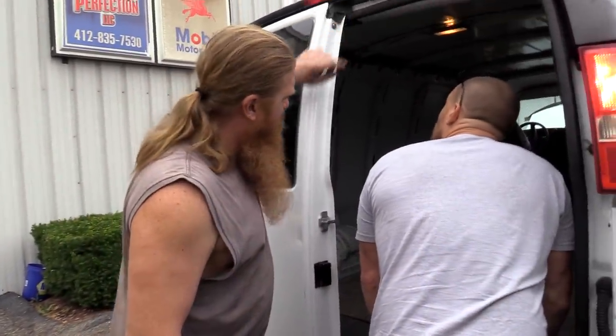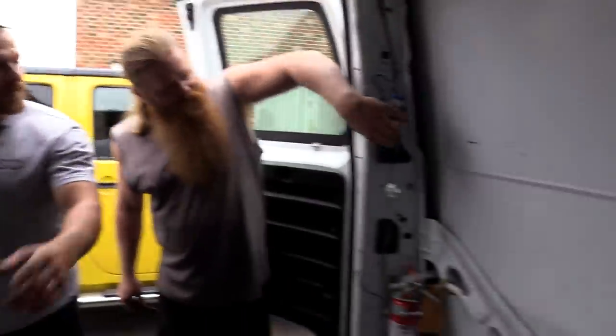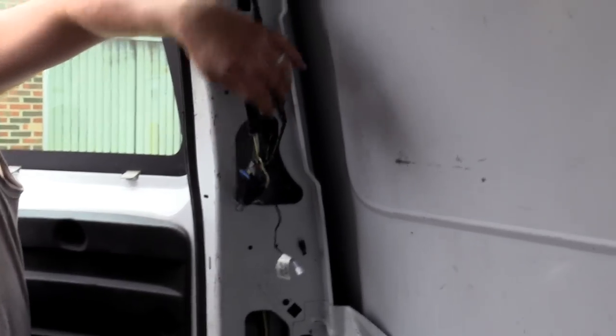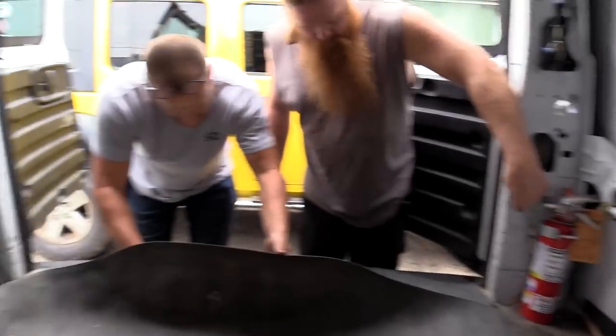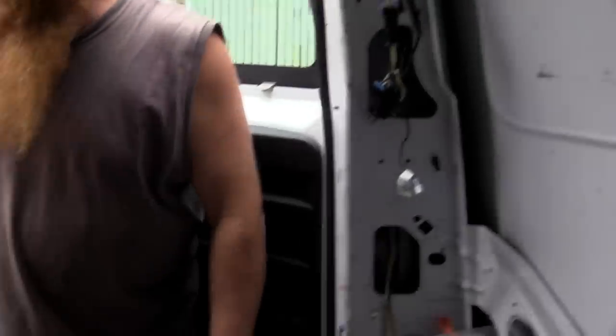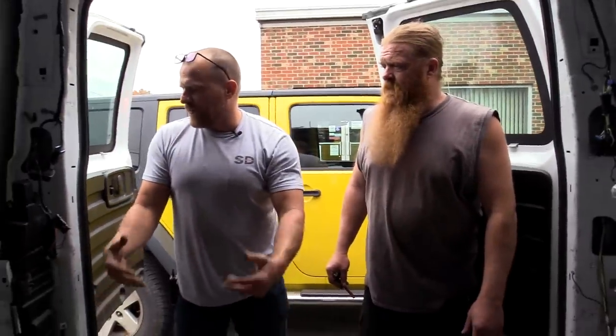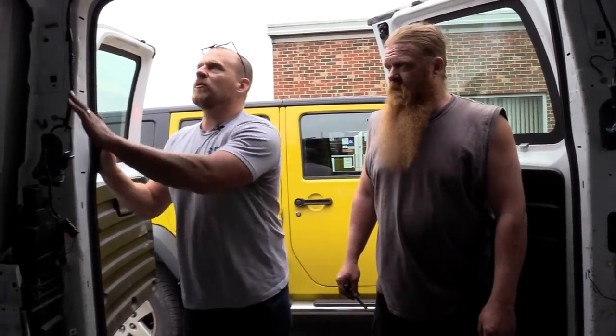This whole thing's been taped up - someone, they're electricians by trade so they work on big stuff. These jumper things go down to trailer stuff and there's a ground that's off here. I'm thinking about whether this is arcing or backfeeding somehow. Caleb had a great question: we now confirmed it's not a faulty BCM, we know it's a blown fuse. The question is what caused it. That's where we put the car up in the air and look along the frame. But if you look at the wiring, it's actually inside the car - keeps it out of all the muck and grime.